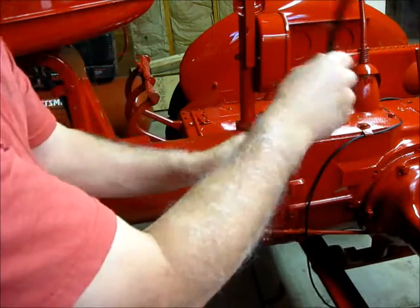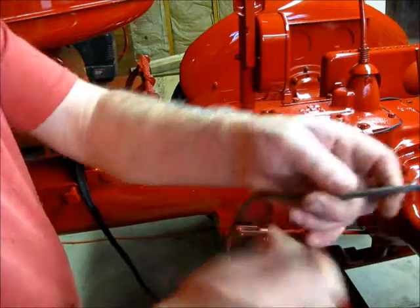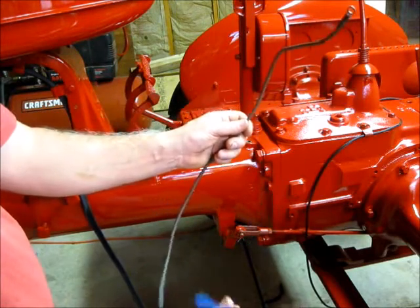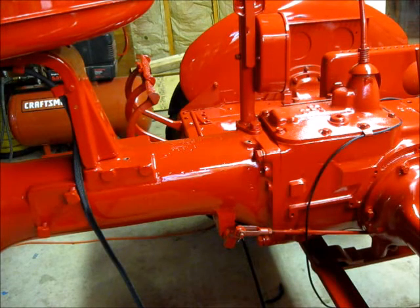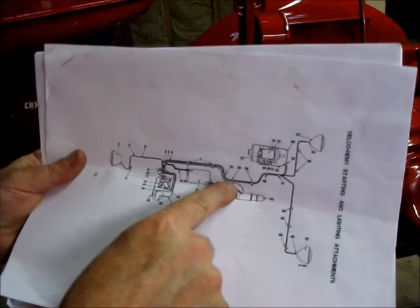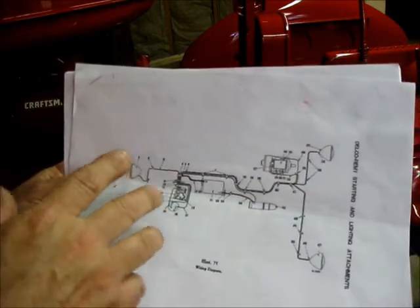For the rear tail light wire, I could cut a small indentation and shove the wire through. The same goes for the starter wire — this runs from the amp meter to the lug on the starter and registers how many amps are on the meter. The diagram in the book shows this wire coming off the starter, going through clips in series all the way back into the box, so technically it runs on the outside.